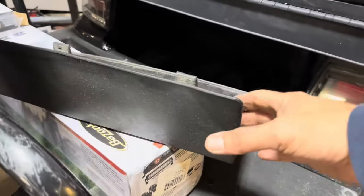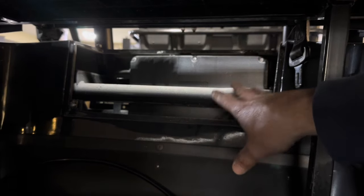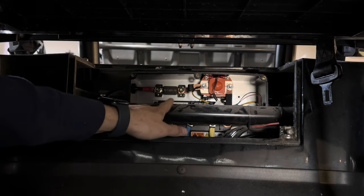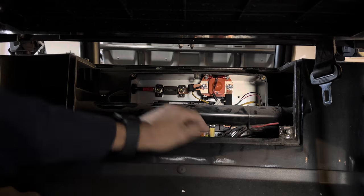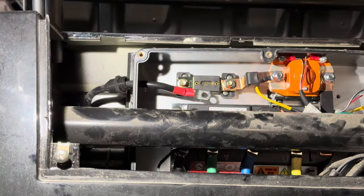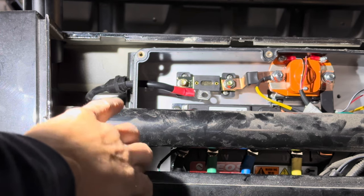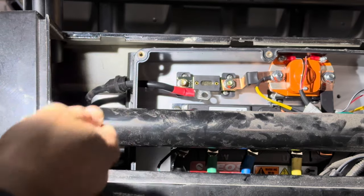Using your Phillips head screwdriver, remove the two screws that hold this panel on — it will give us access to the back of the controller panel. Go ahead and use your Phillips head screwdriver to remove all the screws. Now we're looking at the solenoid and controller. The B negative is going to ground at the controller, and it looks like it's going to be easier to replace the main positive cable. Use your 12 millimeter to remove the nut, unscrew the mounting piece, and pull the wire out.